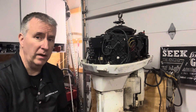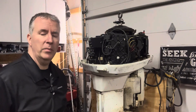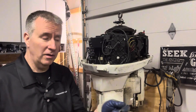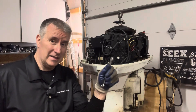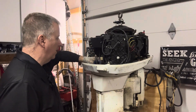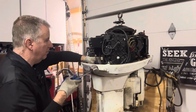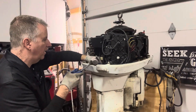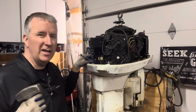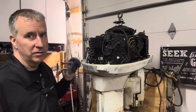This is where you want to be as careful as you can be working on these older motors — you don't want to break a bolt off. If you do it's not the end of the world, but the less of that the easier life is. I switched to a Craftsman wrench because sometimes Harbor Freight tools slip on a bolt where a good Craftsman or Snap-on will not. This one did not slip and I'm able to get a good shot at it, and it is moving. The reason I'm using the impact is because I shock it each time instead of trying to turn it until it gets stuck and snaps. The shock sometimes breaks more stuff loose.